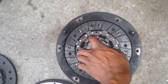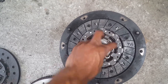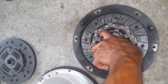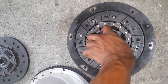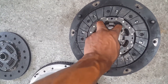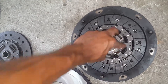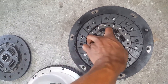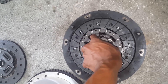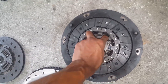It'll grip sometimes and then you'll see it start to pop - just like that. You can actually physically see what happens: the clutch disc is basically hopping and skipping. Sometimes you'll get smooth engagement and sometimes it's difficult. With slight pressure you can see it jump, and that's where I'm having my issues. It's pretty cool to see this outside the car without it running because you'd never see what a clutch disc looks like when it's skipping.